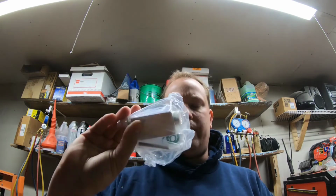that one of the seals sort of let loose for the expansion valve, and what we have right here is our expansion valve for the rear of our 2011 Dodge Grand Caravan. The other issue that I had was because this was already replaced, there was an aftermarket expansion valve used about 5 years ago, and it would stick. Didn't work all that great.